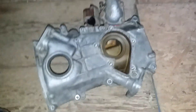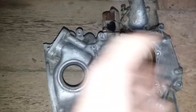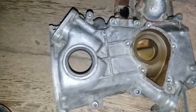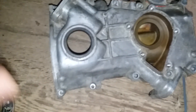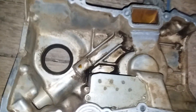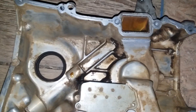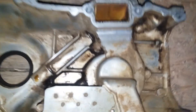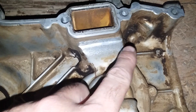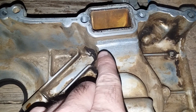Also in the tank was the front cover — you probably saw it in a previous episode where it was completely black and coated with crap everywhere. I was able to tank it for a couple hours with a wire brush and get it at least this clean. If you don't change the oil it just stains and gets tarnished everywhere. This mark here is what the timing chain makes when it starts to wear through the cover after the timing chain guides go away.